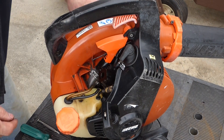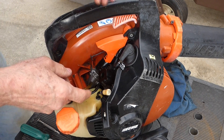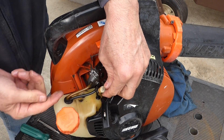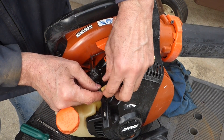What happens is — I cleaned it off a little bit on the top, but that doesn't mean it's open and free. What happens is this builds pressure in the tank to feed the carburetor. It pulls air in, but it won't let air out, and these things clog up.